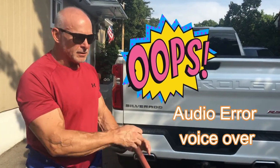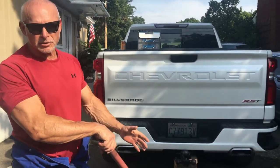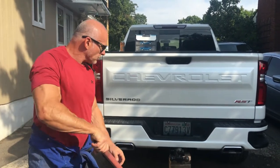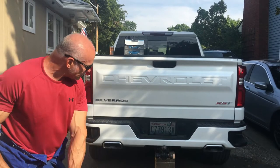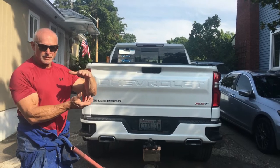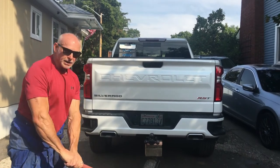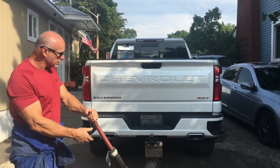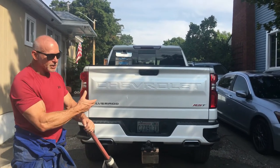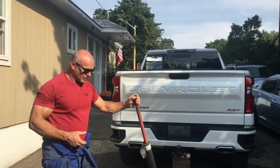What we're doing right now is lifting the back of the truck up a little bit. I normally wouldn't use the hitch to do the jacking up, but I'm only using it to stretch the suspension some — I'm not actually trying to get the tires off the ground. This will just give us a little bit of room between the axle and where we're going to be installing the Timbrens on the frame. Give yourself some space, make sure you can get your hands in there safely, and always use your jack stands. We've got her jacked up, held in place by the safety stands.